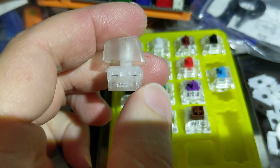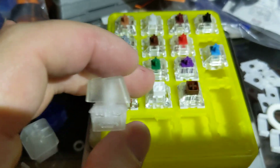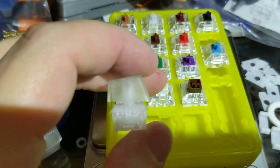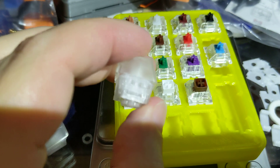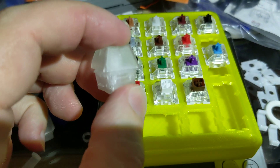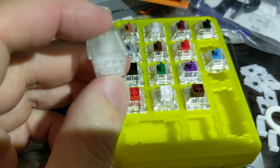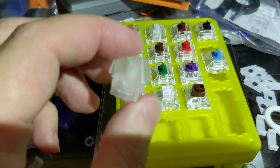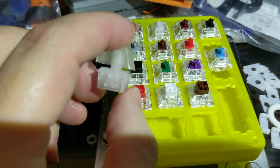It's actually a louder clicky. Oh, it's so satisfying to click it too. It feels very similar to that, but this one is actually much more resistive — I push forward, and then to continue, I actually have to keep pushing harder. It gets harder as you push down. This is a proper beam spring: once you reach that inversion point in the spring, it's actually less force. So it should have this really awesome force curve. It's going to be great. Now I've got to make a whole keyboard of these and really truly give it a try.